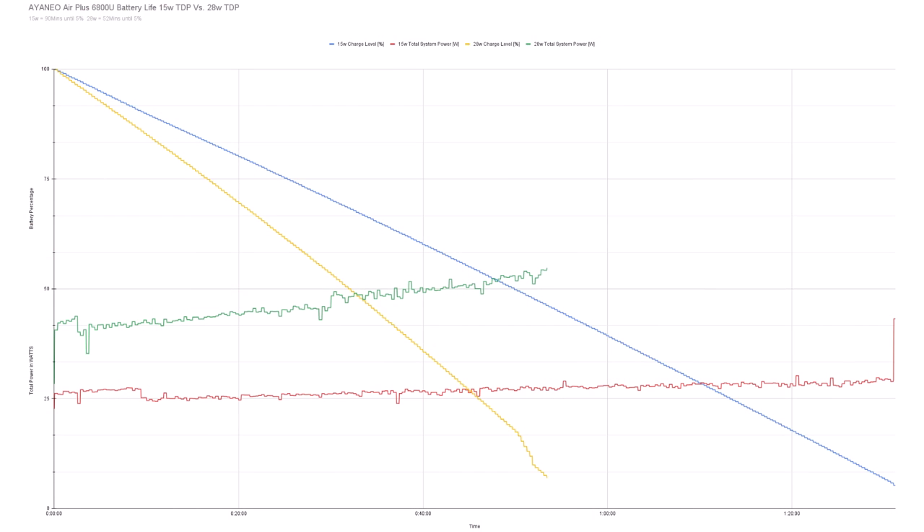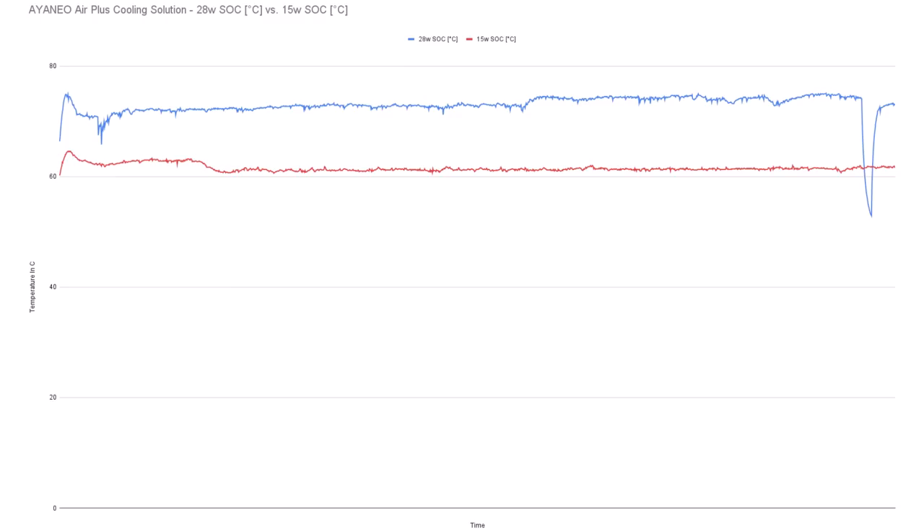The ideal of power and convenience, crammed with as much as they possibly could: a 3S1P 46Wh battery — pretty much the largest you can do — and a very capable thermal solution that has no problems running at 28W for extended lengths of time, staying cleanly under 80 degrees Celsius. I'd personally recommend only doing 28W while plugged in or docked. I'll talk about thermals more later on in this video.